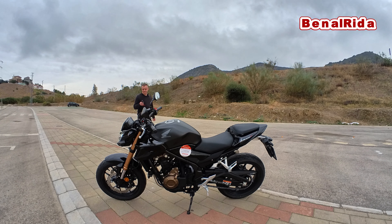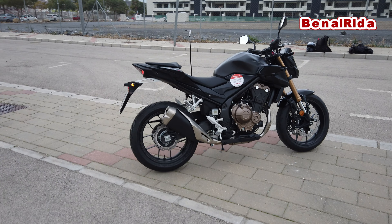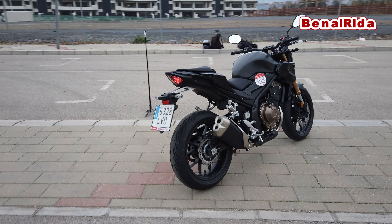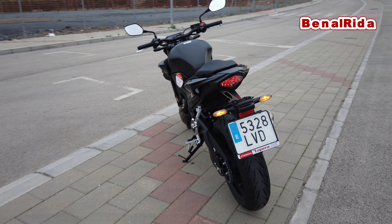This year's model has two disc brakes in the front, which is the biggest change. We have a four-piston 296mm double disc brake in the front. We also have a 41mm Showa upside-down fork in bronze, which looks pretty nice.